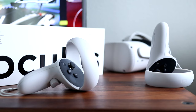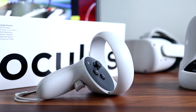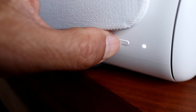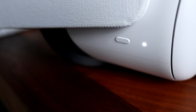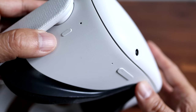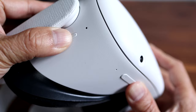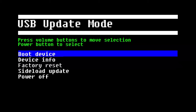If it's not an overheated battery, then a common tip taken from IT professionals is to try a hard reboot — your Oculus headset might just need a good restart. To do this, first power off the Oculus. Then press and hold both the power and volume down buttons for about 3 seconds. The Oculus headset will now start up in update mode. Use your volume buttons to select the option to boot device, then press the power button to select. The Oculus will then restart normally. This reboot will not erase any data stored on the headset, so this is safe to do.